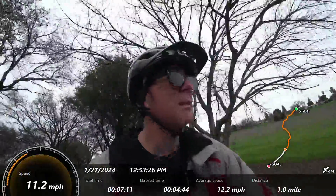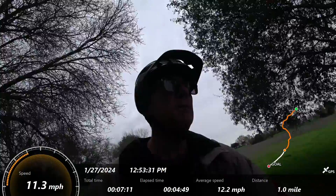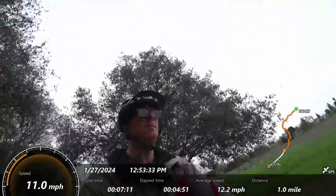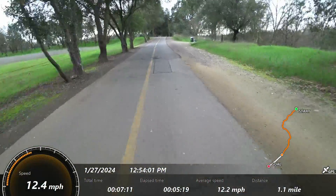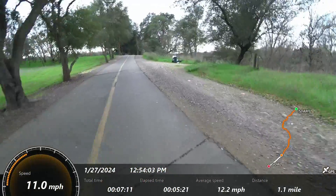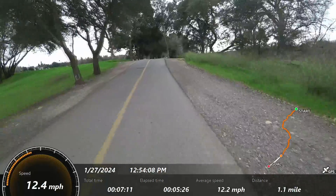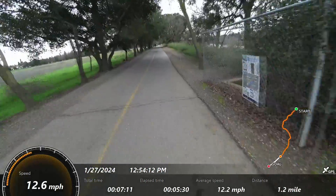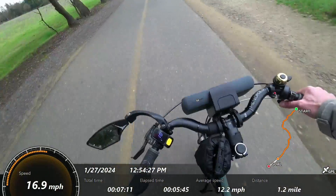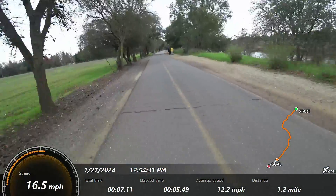That's the biggest challenge depending on your use case — if you're shuttling around kids, the speed control might be an issue. I'm going to demo full throttle right now. At full throttle, with 250 watts at 36 volts, it's not going to accelerate all that strongly. The display is showing 18 mph — it feels about that, maybe a little slower actually.